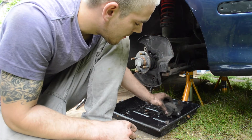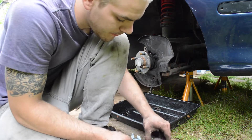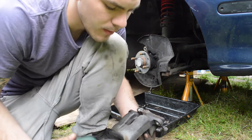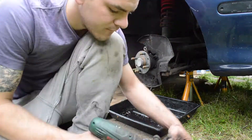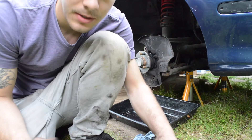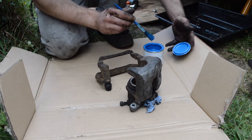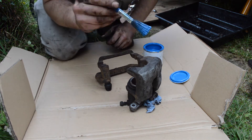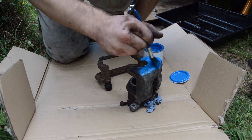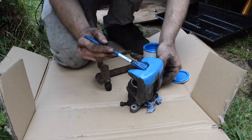Now I'm going to clean this off as well - let's get some of that brake fluid off. That's as much as I'm gonna do on that. I'm going to bang this on charge and then we can start painting it. Now we're painting it - gonna grab this paint here. I'm not going to go too over the top, just basically the bits that you can see. Try and make it nice and neat and quite thin because I want it to dry today. It's actually really good paint - I got this just from eBay, this is E-Tech caliper paint.